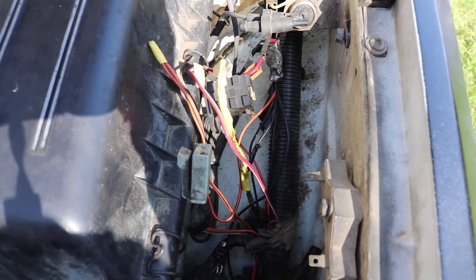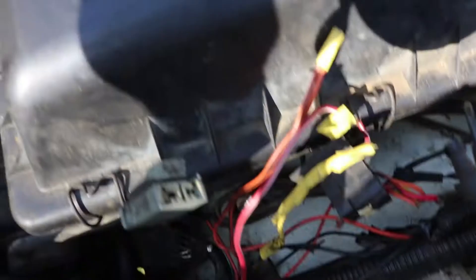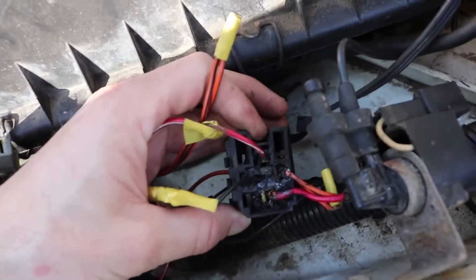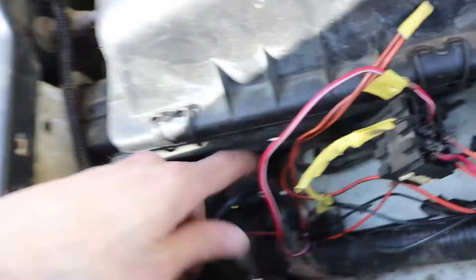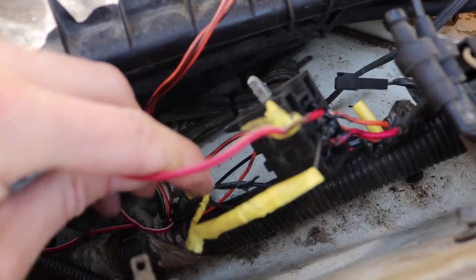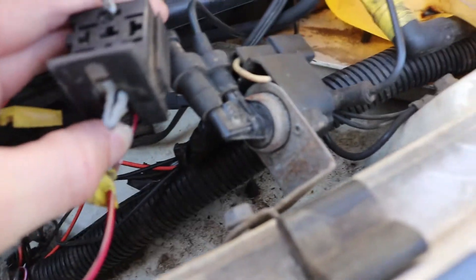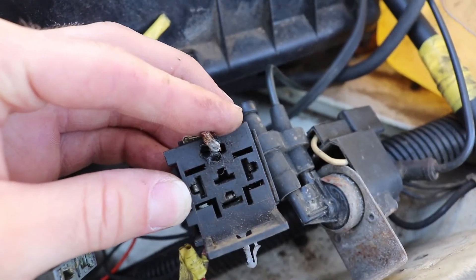Continuing with the theme of bad repairs - the electric fan down here was hardwired. Somebody had installed a switch under the dash and put all this mess of wiring. Can you see that? That is melted - gross. I've started on sorting this out. I'm gonna have to look up the wiring diagrams to see where all this wiring is supposed to go. You can see there are actually drips of solder, so this person did use solder at some point. The relay isn't there anymore - it would have plugged into that block, but they just jammed wires in there and clearly melted the crap out of it.